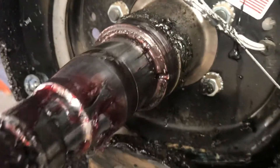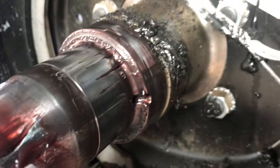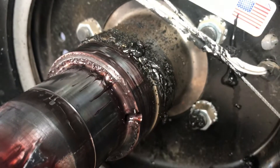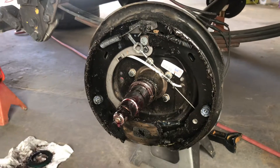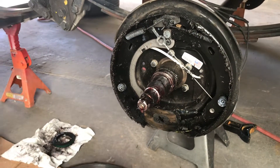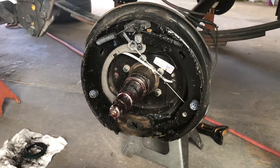If you do not do that, the grease comes through that little hole right there and hydraulically presses grease through the seal and then all over everything else, ruining the backing plates on this brand new trailer. All of this could have been prevented with packing wheel bearings correctly.